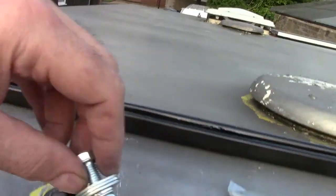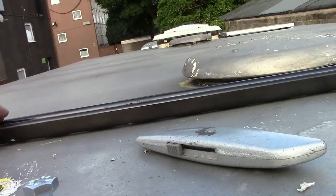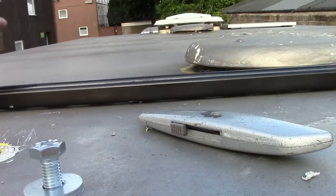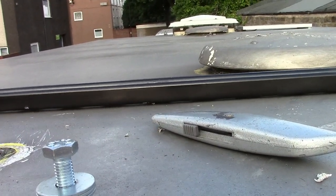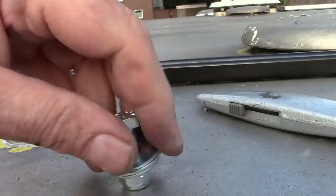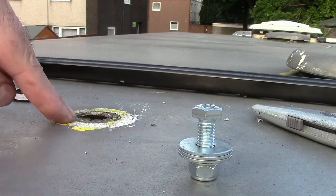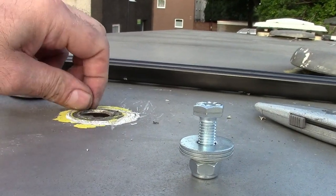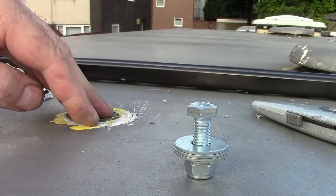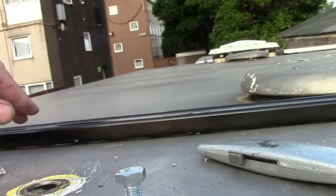The general idea is I'm going to use a thick washer on the roof just to raise this up a little bit for drainage. I'm going to pop to B&Q, get some bigger washers, seal them with Sikaflex inside and outside to the roof, bolt it up, and leave it overnight to dry.